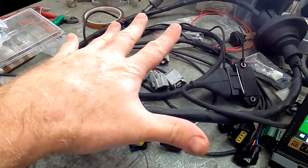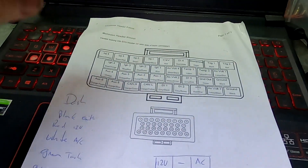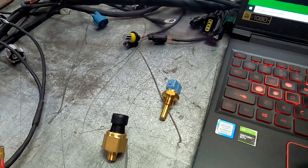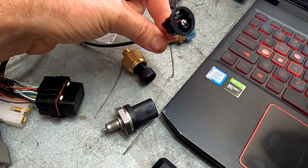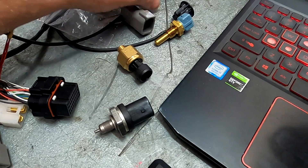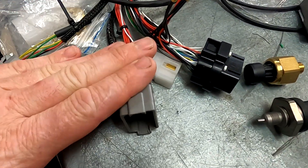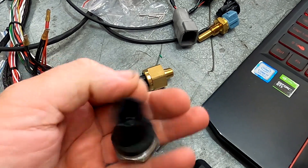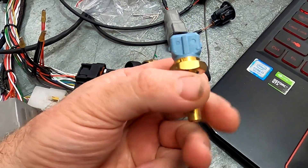What I've done is I've built up a wiring loom for my normal UZ engine and I've made it so it can take either an Atom or a Monsoon. With the Monsoon option I've made up two little looms so we can run either just an oil pressure switch which comes up by the dash, or we can add an oil pressure sensor which can come up to the ECU and the ECU can output an oil light, or we can do that same oil pressure but add an oil temperature as well. That can be on a combination sensor such as this Bosch unit or on a separate fluid temperature sensor — either of them will work just fine.